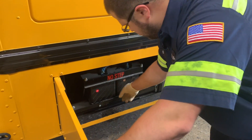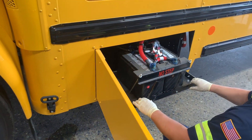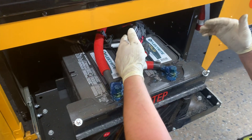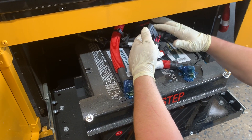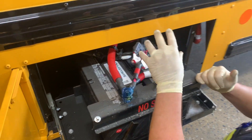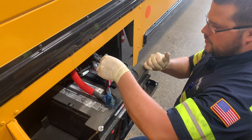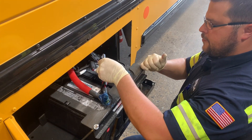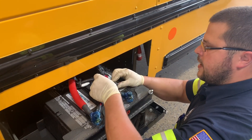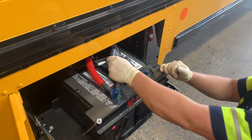This is a brand new bus, so this is actually really nice — latest and greatest. Right here you have something called your clean power harness. This is all your main harnesses — all your main power and ground supply for your trans, your DEF feed fuse, and then your engine ECM. Those are actually your main fundamental components of the vehicle.